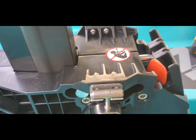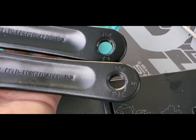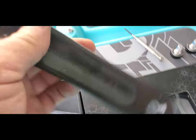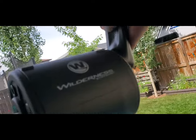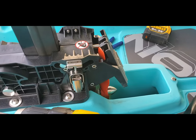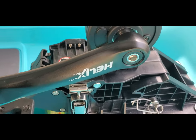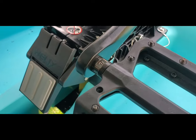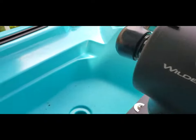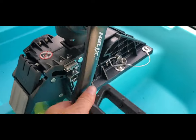Next, we're going to put the pedals on. When you're looking at your crank arms, one is listed as right, one as left — make sure you put them in correctly. You want right up and left down. We'll install those now. The crank arms are installed. Also be sure when putting your pedals on, they are marked for right and left, so make sure you get that correct.